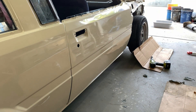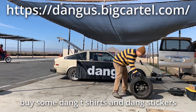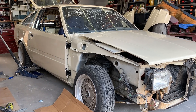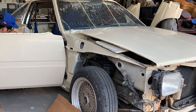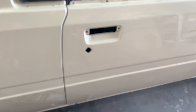When I open this door it's gonna sag. We're gonna lift this up and we can see the striker — gonna go for around there. As you can tell, lots of adjustment. I wasn't sure of the body gap; luckily I have another car. That's a little too close for comfort, I need to pry this back.